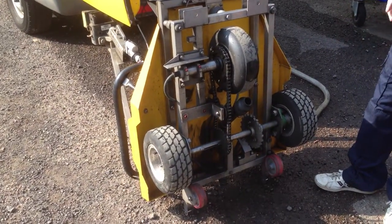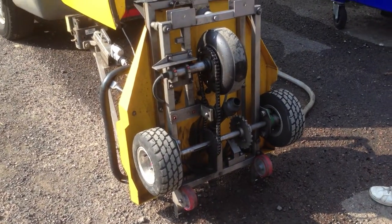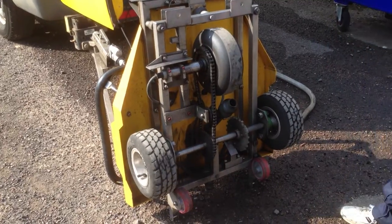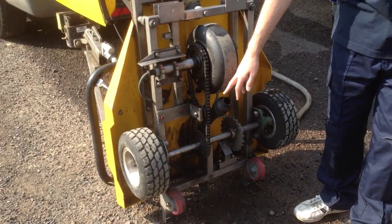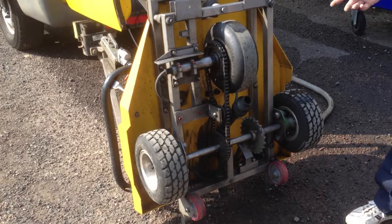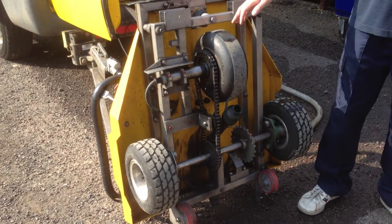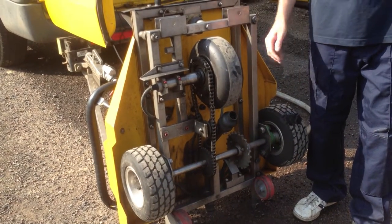There are a few things we always have to check before we go out. We check the three wheels are in alignment — that's generally the visual thing; you can see if anything looks amiss. And as well the chain tension — that's important, that has to be 20mm, give or take 2mm either side. If it's slightly less or slightly higher, this changes how quickly this wheel spins.